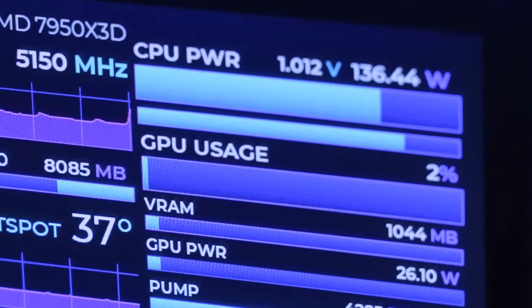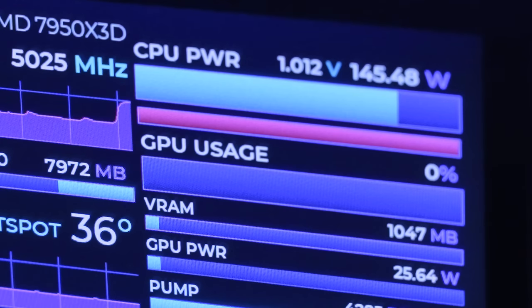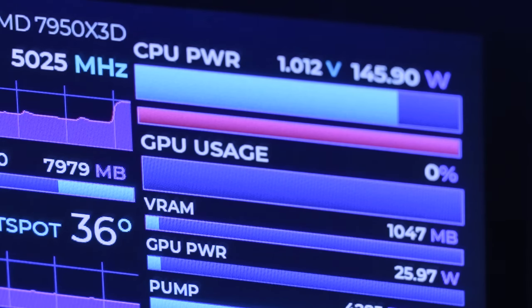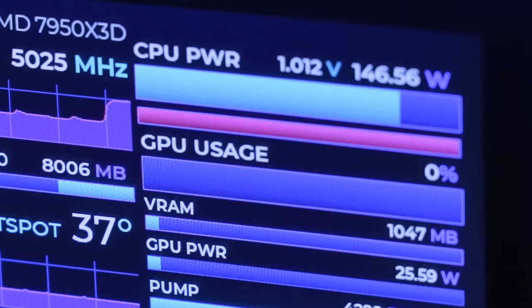Gaming has been great as long as I'm not running AMD Expo. The curve optimizer has been fine and doesn't really change voltage much. Because the V-cache is extremely temperature-sensitive, the CPU runs at a much lower voltage, which is why the TDP is so much lower. Under load it runs at about 145 to 155 watts, with 160 being the max. Even with PBO and curve optimizer set much higher than stock, it doesn't push voltage or wattage noticeably higher — I'll see anywhere between 140 and 155 watts on my sensor panel.